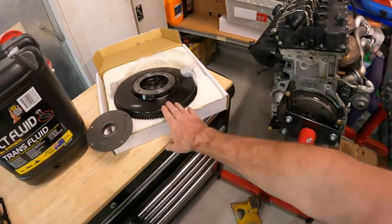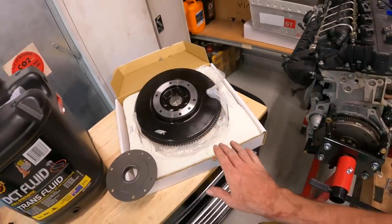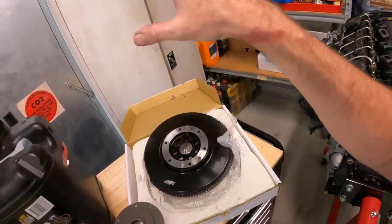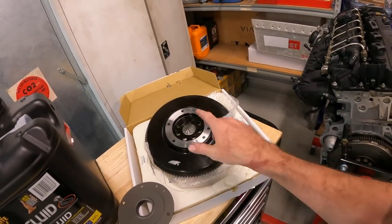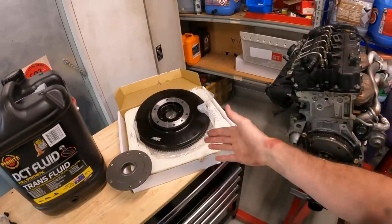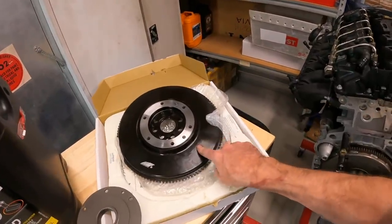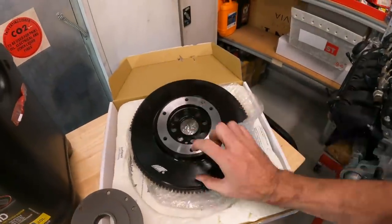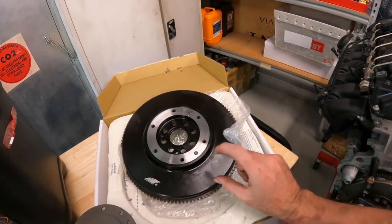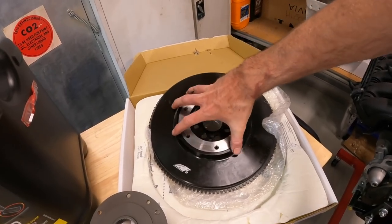This one is made by M-Factory. These weren't originally conceived for DCT swaps, but most people end up buying them for that. These are a single-mass flywheel and about half the weight of the original, which makes a big difference on performance. The main reason these got made was the issue of dual-mass flywheels — as they get older, the dampening starts to die, and when you wind the power up, the two bits of metal in the flywheel will bang on each other and cause false knock.